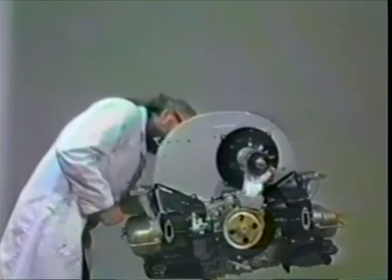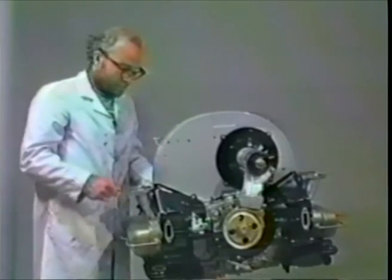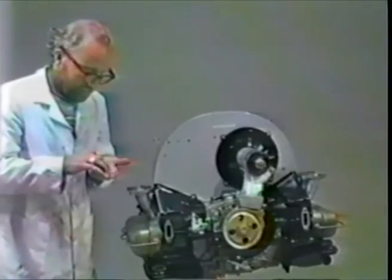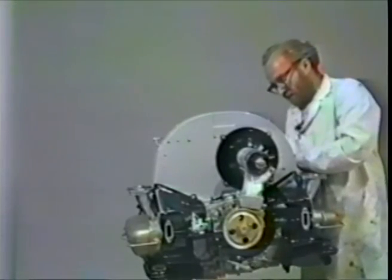Now the side vertical pieces, you can use one of 2 types. If you're using Solex intake manifolds, you can use Solex intake manifold split side vertical pieces. But if you only got Zenith, you can also use the Zenith sheet metal pieces. And I can show you how you do that. It involves a little cutting or trimming of the Zenith sheet metal piece.